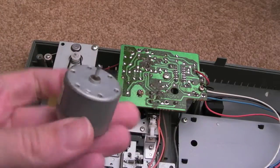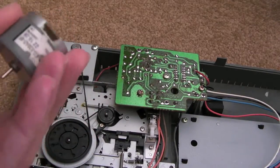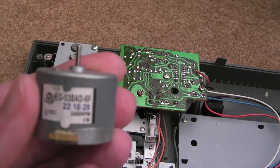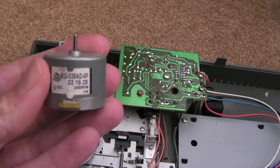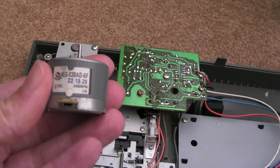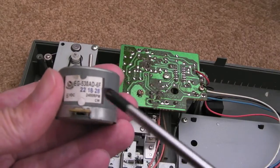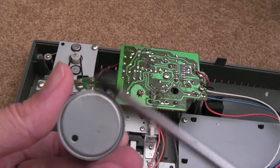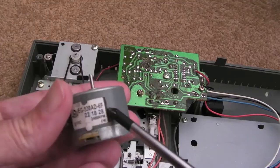So I've got a replacement motor here, and I'm going to have a go at fitting this now. It's not exactly the right one, but hopefully it's got the right number of revolutions and the right voltage — it's 2400 RPM and the right direction, clockwise. Well, you could probably just invert it by swapping plus and minus, though I'm not sure if there's any circuitry to stop you from doing that.